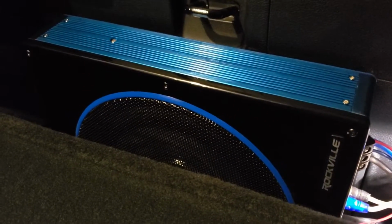Where to buy that piece, I'll put in the description. But I will tell you, the key to this whole thing is to use the LOC from the head unit. If you're getting an aftermarket deck, it doesn't matter. But if you're using the factory deck, which I wanted to, because I didn't want to lose any functionality, having a high input to low output converter that's powered is the key. You can't just get a passive one, you need to get an active one.